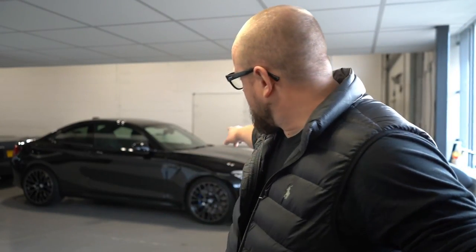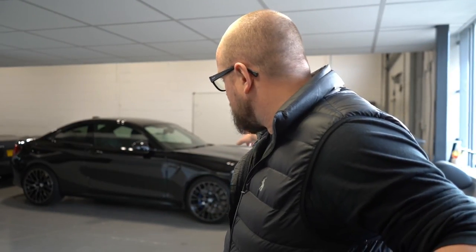This is Carl from Studio Incar. We're going to run you through this new M2 Competition. We're going to do an Eton drop-fit front speaker upgrade — they go in all the original locations, but we're going to wire them actively so we can take control. We're going to use an Audison F8.9 bit amplifier, the Forza amplifier, active sub box, and HK integration as well. The car has factory HK, but we'll go into a little bit more detail.